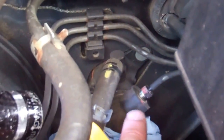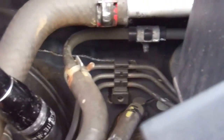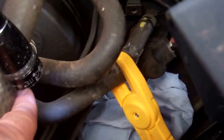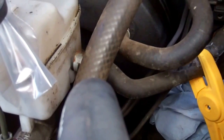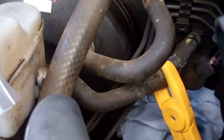We've got the brake reservoir. Interestingly, the clutch cylinder is this one down here, and it's got a pipe coming out here which goes down to the gearbox where the clutch slave cylinder is. We've also got a rubber pipe with a plastic clamp on — that won't be there on your car. It actually sucks brake fluid for the clutch. The point it takes it is above the minimum on the brake cylinder, so it would never cause a brake failure. But if you have a clutch problem, you really want to fix it quickly because it's going to be sucking your brake fluid. We weren't having a fluid loss — it was just pushing past the seals in the master cylinder, we think.